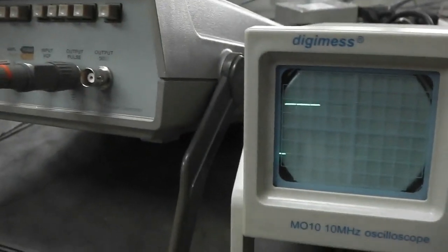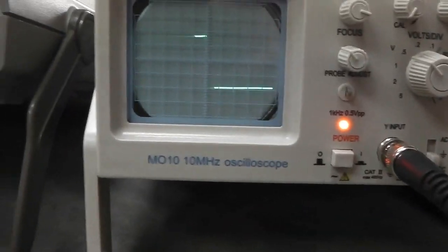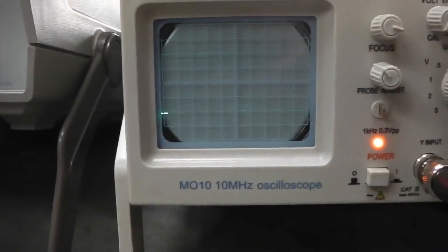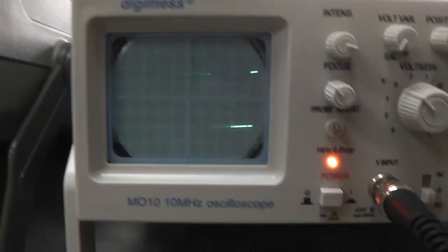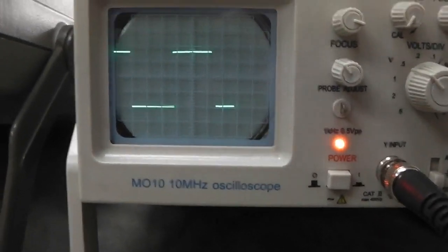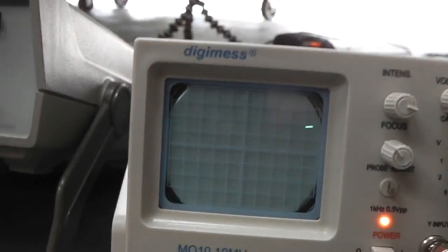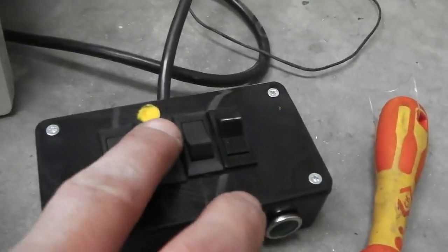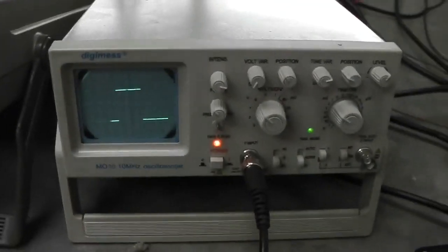Approximately 40. There'll be a point where this unit won't let me lock on. Looks like it won't let you lock on there. That's too slow. There we go. We're on there. That's about 40 now. So cancel that. Just hit the brakes. That cancels it. So we just want to make sure that it isn't too much revs. We don't know what 40 equates to on throttle.